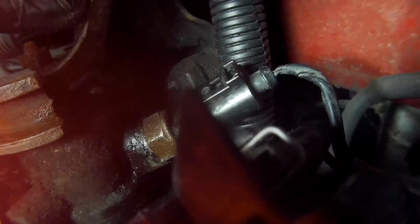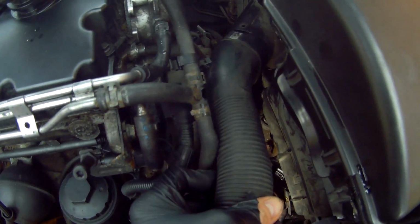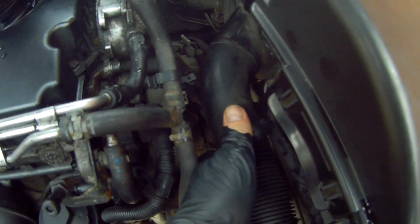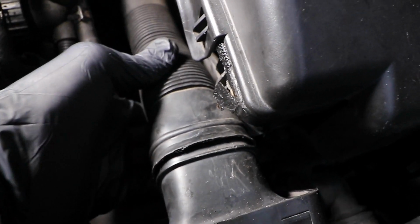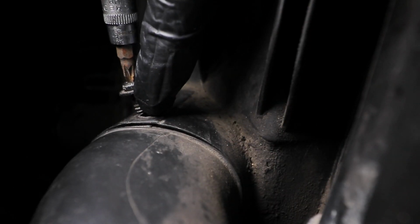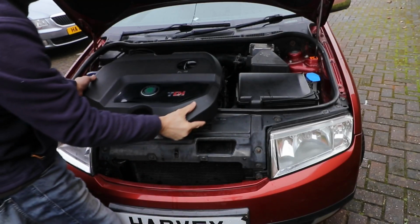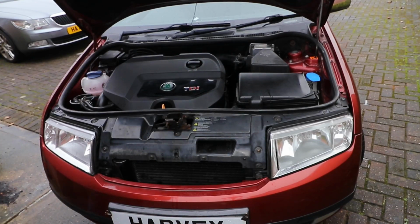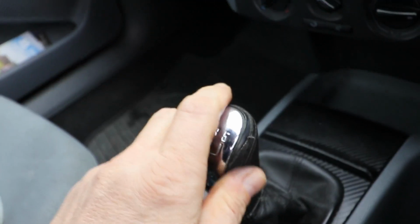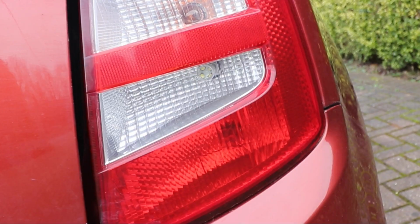Reattach the connector. Refit the air intake pipe back into the air box by lining up the screw hole. And refit the ducting by jiggling it over the front panel mount. And then don't forget the little grub screw. And we're all done. Just have to retest it after reinstalling the switch with the gear selector in reverse gear. Left hand side, OK, and the right.